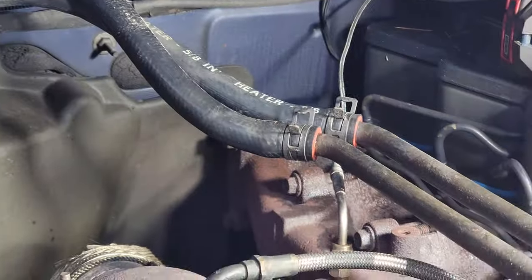Going over the intake and exhaust plumbing: the intake is routed underneath with one clamp at the end pointing down into the inner fender where it gets nice cold air. The exhaust came with a stainless steel clamp — I put one clamp here and one down below. Keep in mind the exhaust must not touch anything flammable as it goes down, so it's routed above both hoses. The bottom clamp goes through the bottom of the frame rail, and I pointed the end of the exhaust tube right at the oil pan so you get hot air blowing on the oil pan to heat that oil before you start the truck.